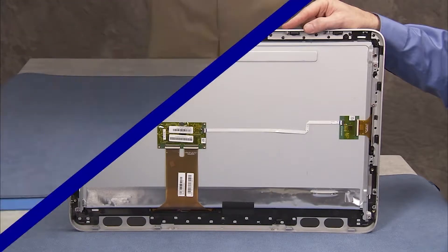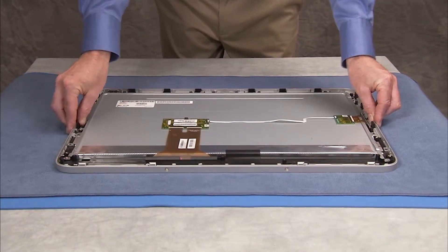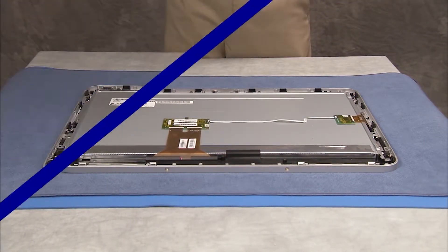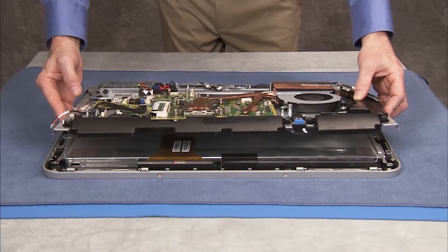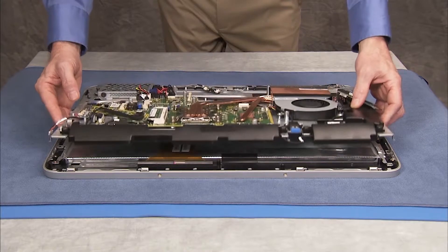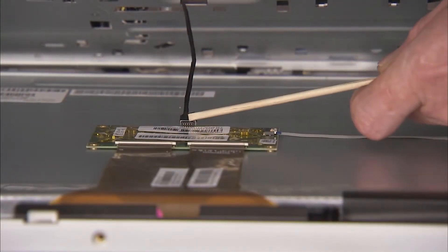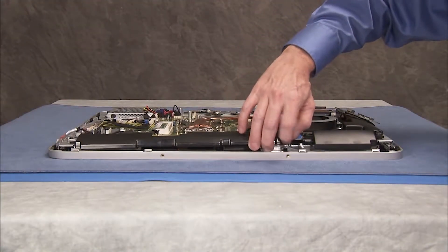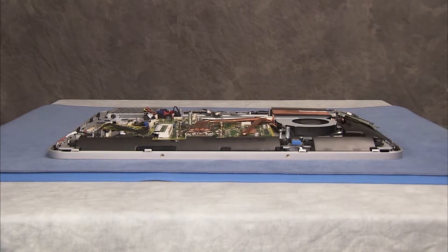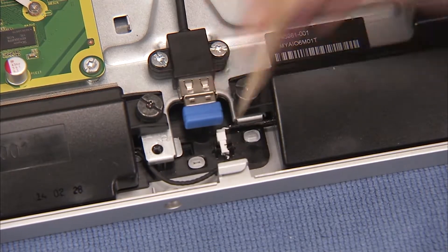To replace the touch panel kit, place the touch panel assembly face down on a soft flat surface. Align the top of the middle frame assembly over the touch panel. Connect the touch control board connector to the board before fully lowering the middle frame assembly into place. Tuck the speaker's interconnector into its cable guide on the front bezel.